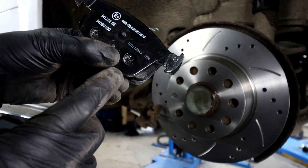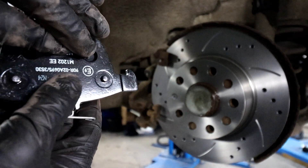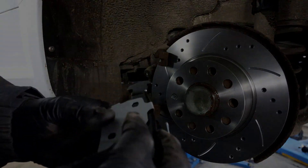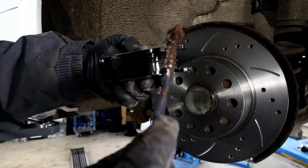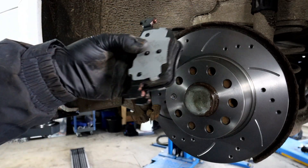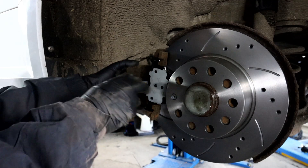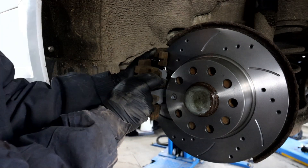Now with the brake pads — you've got two different ones. One has little tabs on it and the other one hasn't. The one without tabs is going to go on the inside, facing the caliper, and this one goes on the outside. I also have covers to fit on there. With the pads I like to put a bit of copper grease on the bits they're going to be sliding. Make sure you've got them the right way around — check they're nice and free on there. Same for the inner one — that's nice and free. You've got the spring on the inner one so you're going to be fighting against it, but it's fine. The caliper is wound back in so it should just slide on. There you go.